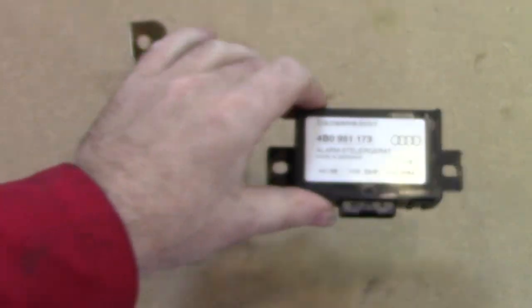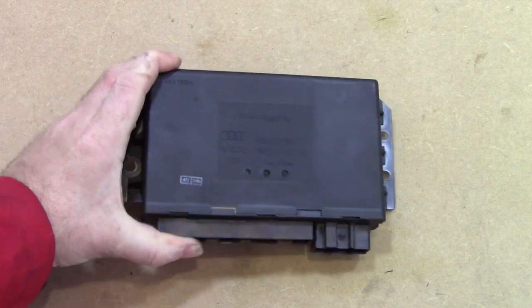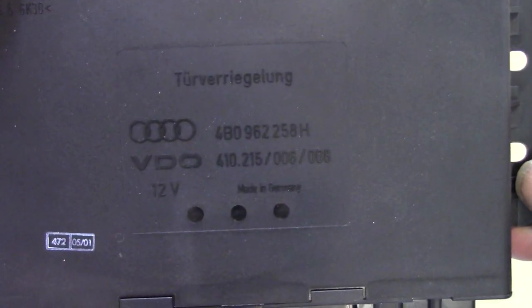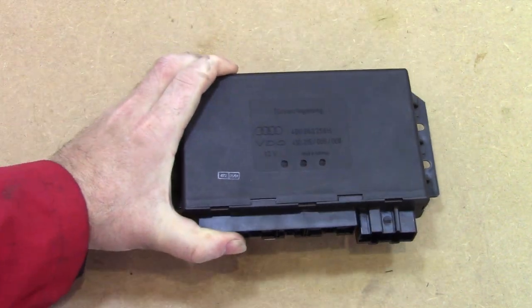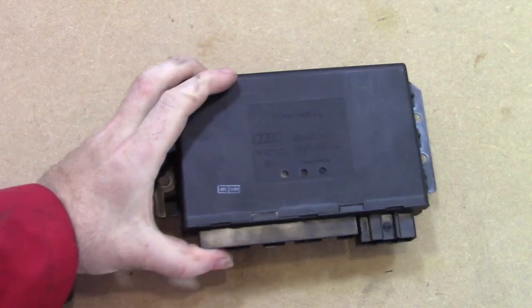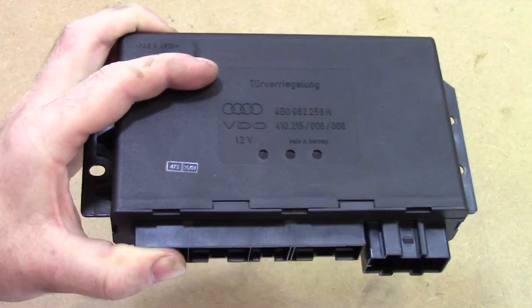And I do want to use these two. So I'm going to be keeping them. And then there's this mystery box. And hopefully you can make that out. It's a better picture. Well, apparently this is the comfort control module, which was correctly pointed out by Dom, one of my subscribers. So yeah, you're right on this one. This controls the electric windows and the central locking and all that sort of stuff with regards to the key fob. So I will be keeping this.